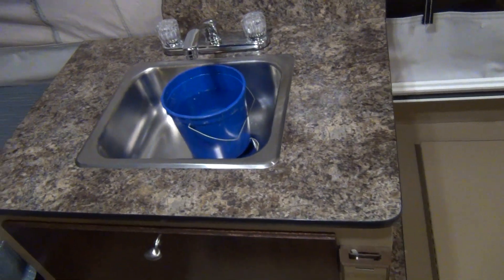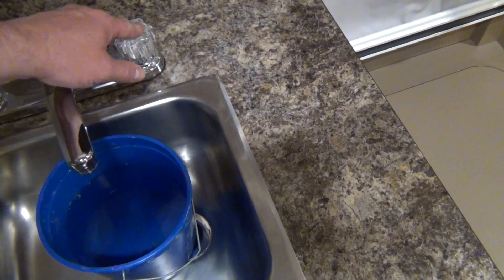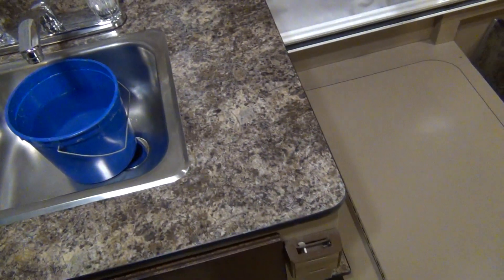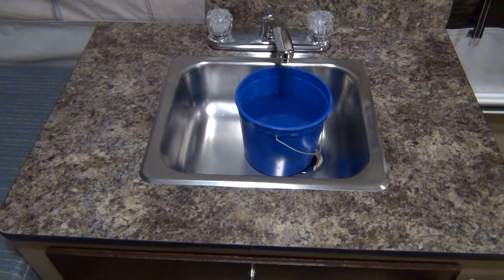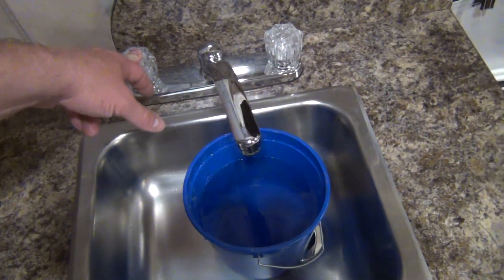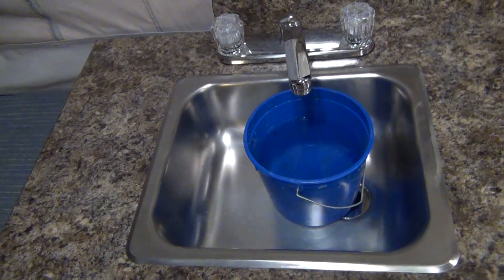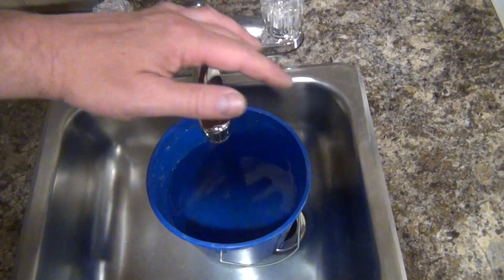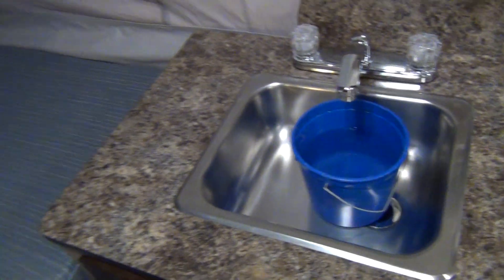That's my newest project — I just have to do a few more tests. One of these days I've got to hook up city water and open this valve to see if water will back-feed all the way to the storage tank, and whether the pump will stop the back flow. If it doesn't, I'll have to put in a backflow valve, but I'm worried that'll kill my pressure since you still need a little pressure to open the valve. As long as the valve is shut the city water shouldn't back through, but I'm worried about someone leaving it open a little — water could start filling the tank and overflowing.